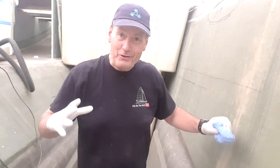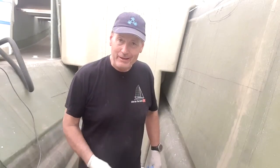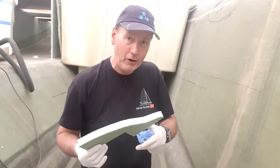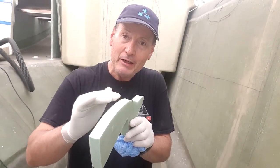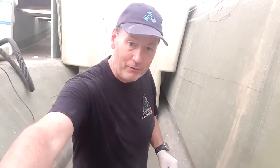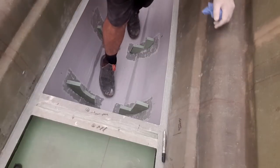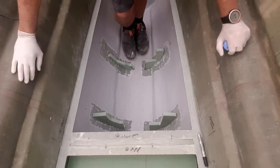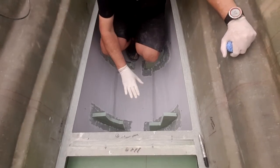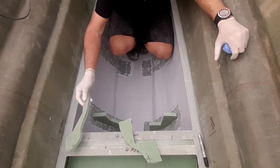Well, that was rather unpleasant. I need to clean the region I've just sanded with that roller sander — without it I'd be in there with a flap disc with crap going everywhere. I need to embed these with the sea-lite foam before I do my tabbing. I've also coved the foam so I can get plenty of bedding compound into the bedding region before gluing it to the side of the boat. These go in place like so and form the basis of my tank bed. It's actually easier to glass them in situ and then tidy them up than to do them bespoke outside and fit them.